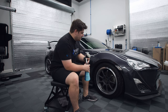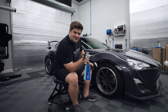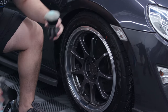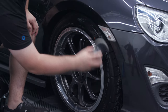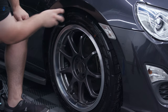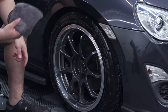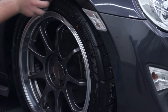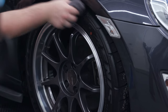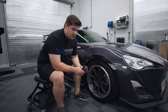The car has been fully washed and fully dried. We just finished up the drying aid. So now we're on to our last step, which is to apply some OG Tire Dressing to the tires. I'll get my curveball brush, spray a little bit in there, and then we can apply this all over the tire. I'm going to apply some tire dressing to the other three tires, and then we'll come back and buff it off to a matte finish with our towel. Once your tires are buffed down to the finish that you're looking for, you are completely done with the wheels.